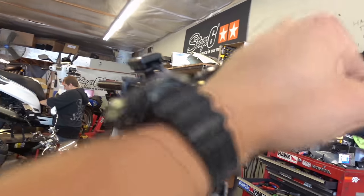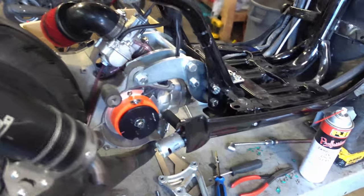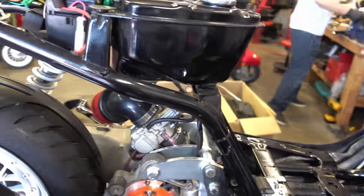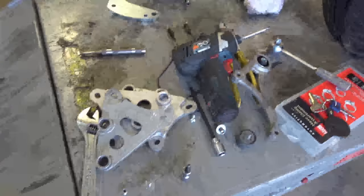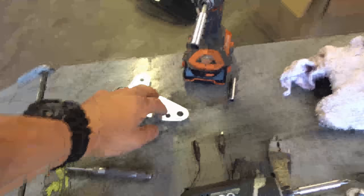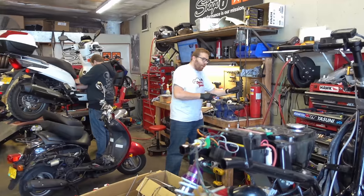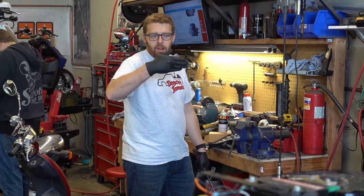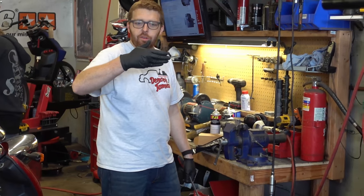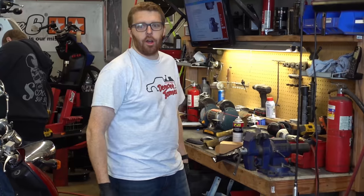So it quick throttles, yeah it runs. The next step is the radiator, put the fairings on, the tire, wire up the tail light in the back. Carter's trying a bunch of different options with pipe brackets and bits and pieces — hand filing over here, good old-fashioned hand labor. It's all the little stuff no one thinks about. Like when you do a wide tire, it doesn't just make the exhaust go to the right — it has to shift so it's going to the right and forward, so none of your brackets line up.